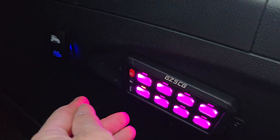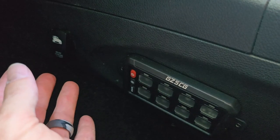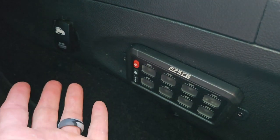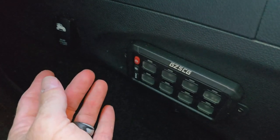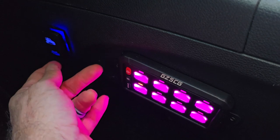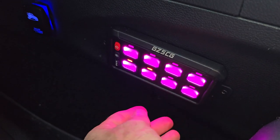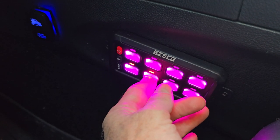I did not use the reverse switch, the brake pedal switch, or the turn signals — I didn't need all that. I have them on my vehicle but I didn't want anything that high. I'm not using this unless I'm off-road, so I put it that way. But I did use the reverse light — the white lights in the middle of the bar. What I did there is you turn the power to the switch on, and then I can come over here to this middle one and that will turn my white reverse light on. So whether I'm at camp or whatever, if I want to light the back of the vehicle up or need to back up into something, I can just hit this button and that white light comes on.